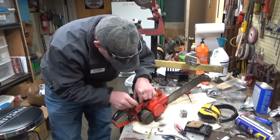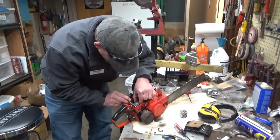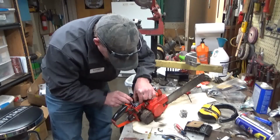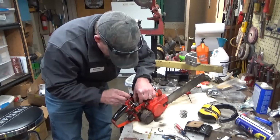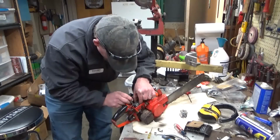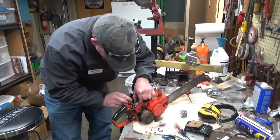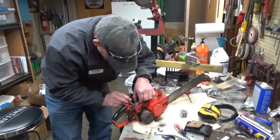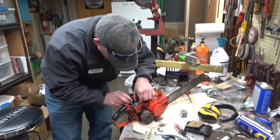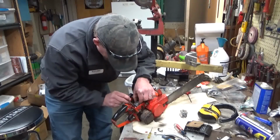You got to mess with the choke position on these as well, so that you can get in here and access this screw over by the muffler. The choke's got to be on roughly the half choke setting, so it'll clear both the butterfly and the arm on the carburetor itself. And then on the other side you need it fully closed.